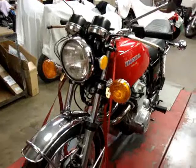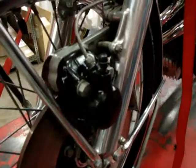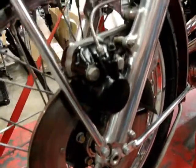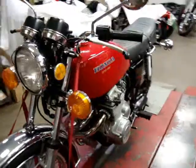Got the electrical issue straightened out, which I'll show you the cause of and the results of in a moment. We've got the front caliper rebuilt — all new parts in there with the piston, the seal, new fluid, everything's bled out good. We also rebuilt the master cylinder in the course of that as well, so everything's working great. You've got a good front brake now.